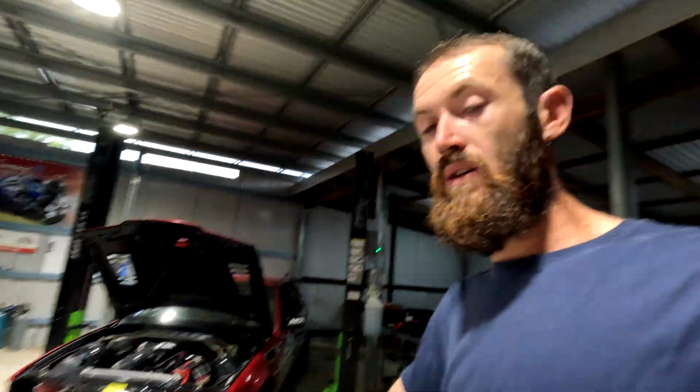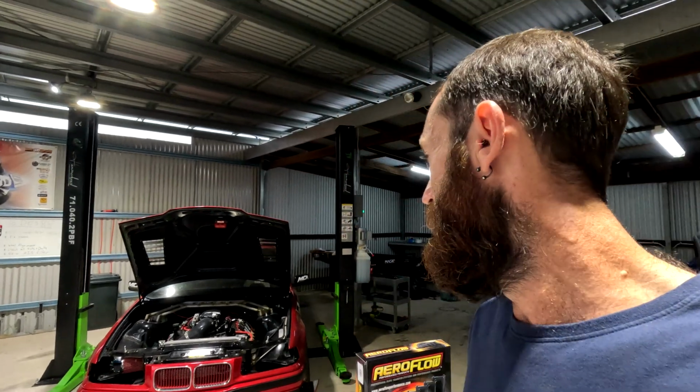So that's good, we got one. We're not running a fan, we're not running a thermostat because it's not a street car. She's gonna live at 6,000 RPM, and it's gonna be constantly getting some airflow. So we're gonna try it, see how it goes. Some of you may have already tried this, so let me know if it doesn't work, and I may have time to put a fan on it or a thermostat.